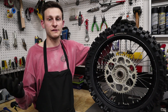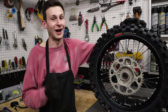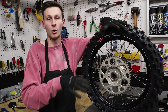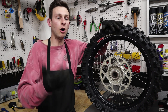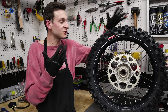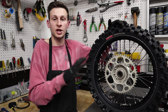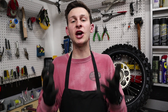Now all you've got to do is repeat those steps and do it on the front, and you guys will be set. I think the fronts are a lot easier — if you can do a rear, you will have no problem doing the front. You saw with the bucket it was flopping back and forth a bit, but with a tire changing stand it eliminates that completely so the tire is really secure. Having the right tools — three tire irons, valve core remover — makes it a lot more stress free. But like I said, there's not one way to change a tire, and there are plenty of people out there who might have other tips and tricks.